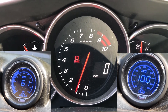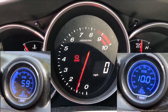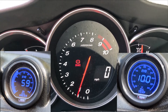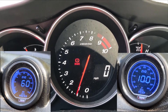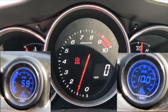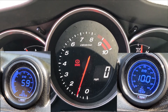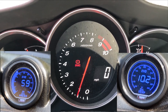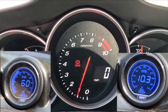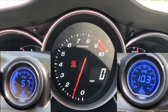When I started it, it was at over 150 PSI of oil pressure upon startup with 20W50. It's 70 degrees, the oil temp is the same as outside — this is the first start of the morning. As the oil warms up, even when warm it's still pushing a ridiculous amount of oil pressure through the system. We just saw the oil temperature go to 102–103 degrees now, and the cooling gauge is starting to creep up a little bit.